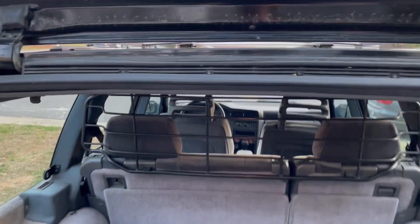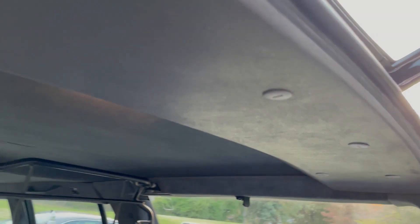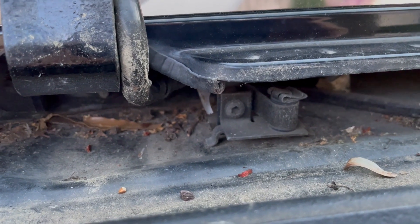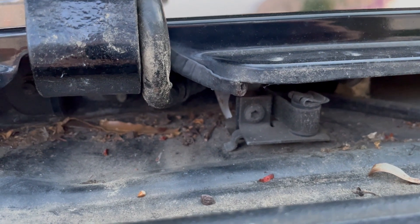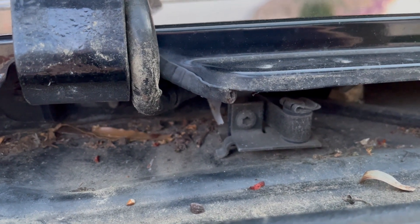There is also a trim panel up here that has several flat head plastic fasteners, so I'll go ahead and remove those as well as the Phillips head fasteners and show you what it looks like inside. There is also one Torx bit screw on the left side underneath the hinge — this holds in the wiring harness. It's just easier to take that out so you can fish out the harness all as one piece.